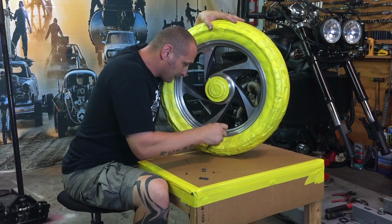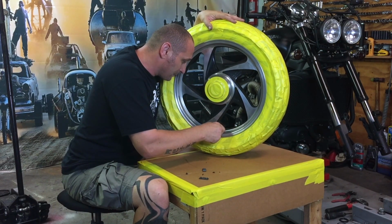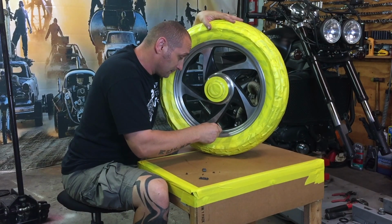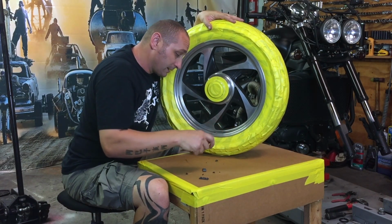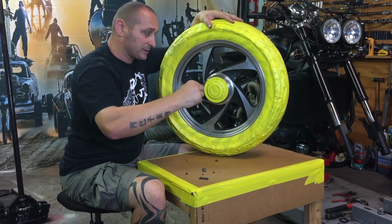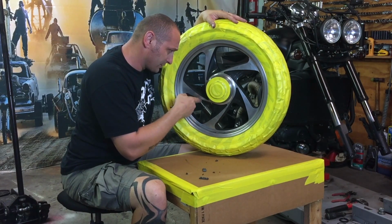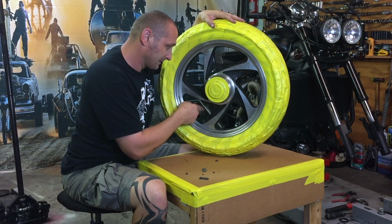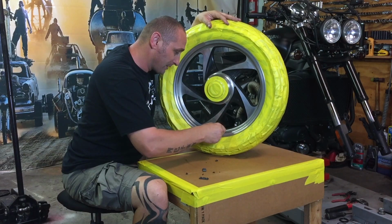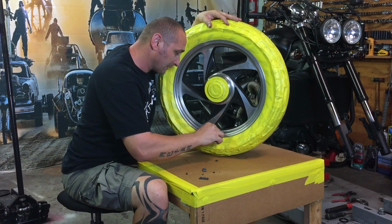And then the painting work, everything is done. Of course, before you put the weight on, I'm going to install the bearing first. I'm not going to use the factory axle, because the wheel is not supposed to be turning on the axle when I do the balancing, so I have to find something thinner. The axle itself is at least an inch, so I'll try to get a half inch or three-quarter inch straight bar, and that's going to be my temporary axle until I do the balancing.